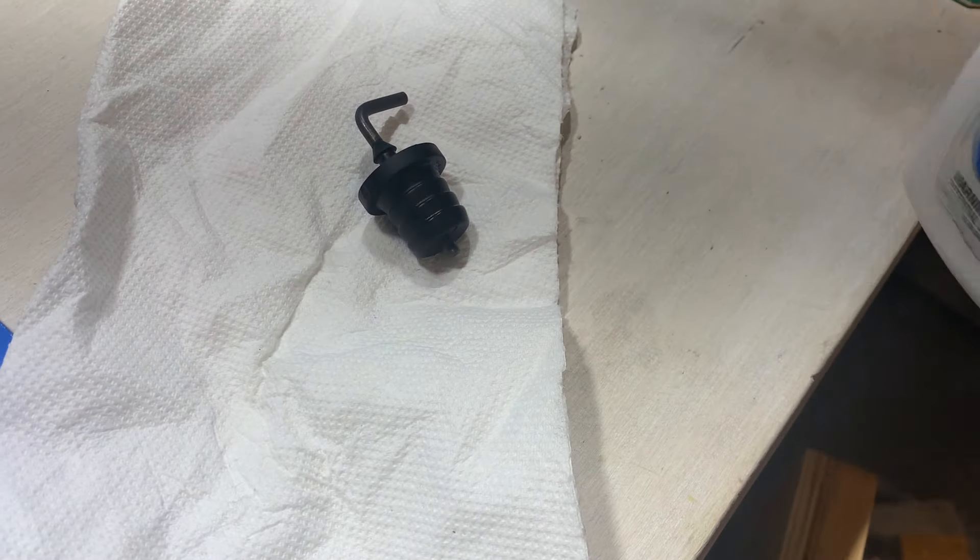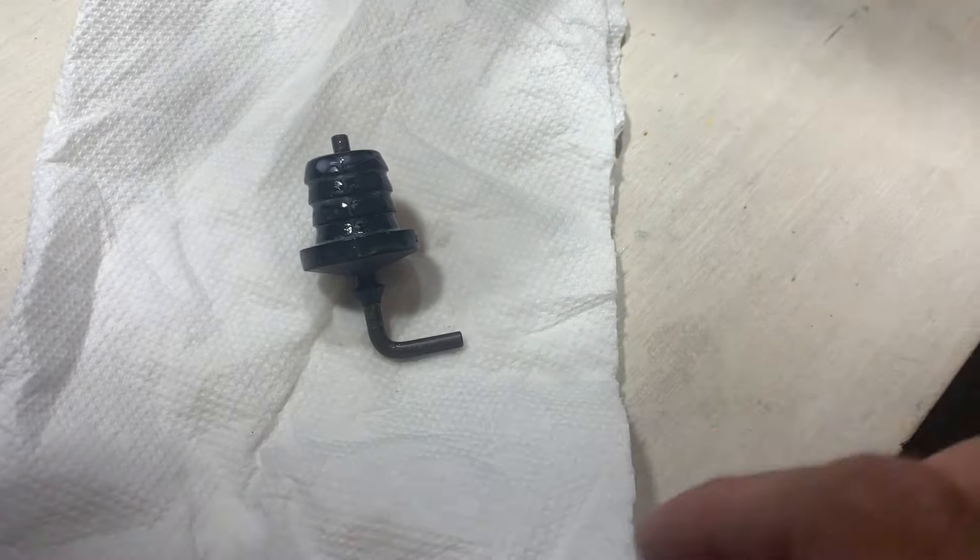It's really dripping now — it just took a minute to catch up. Thread that bolt back in. This check bolt has a slightly different torque spec but I usually torque it to about 35 foot-pounds, same as the other one, then wipe up all the excess. I usually spray a little 303 protectant on all the rubber parts and wipe everything down well before putting it back.